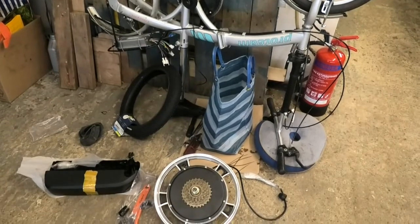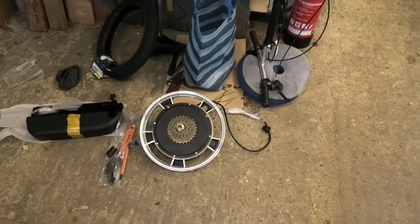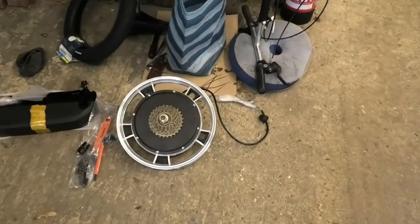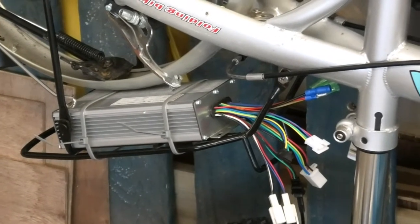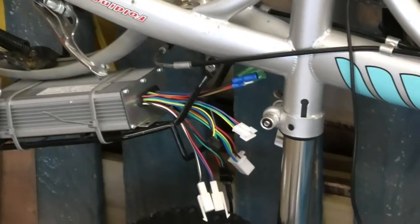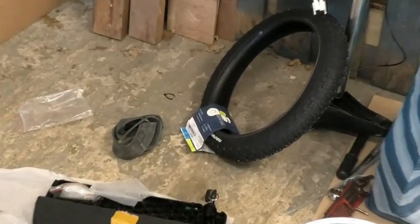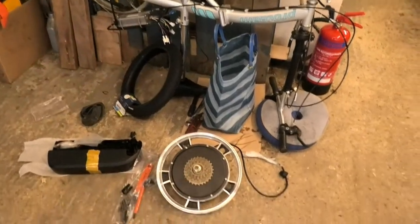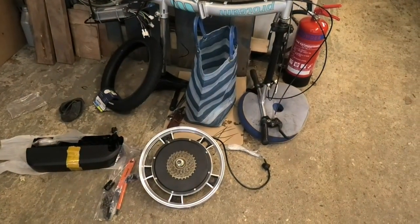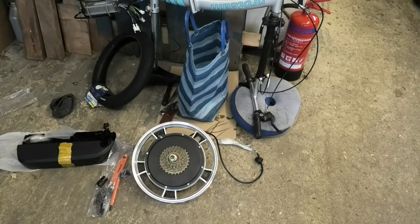I did want to tackle this project myself, so I went ahead and started buying things like the electric motor. I've got the motor there — the motor came with a kit, it came with a controller, which I just cable tied to the back of the bike. I haven't wired anything yet. I also had to buy a tire, and the tire needed the inner tube as well. The tire on this is a little bit thicker than the original wheel. The electric wheel is a 16 inch by 2.125, and my original one is 16 inch by 1.75, so it's a little bit thicker, and I'm hoping it will all fit nicely.